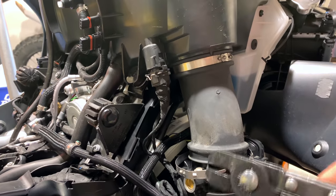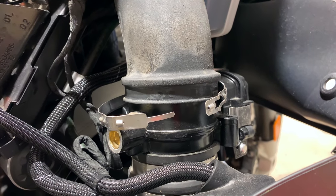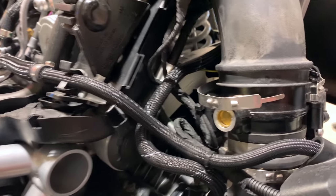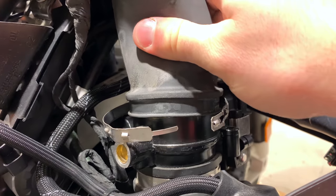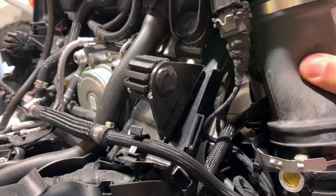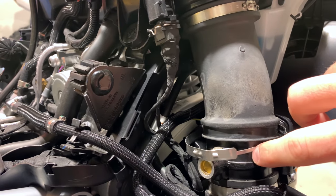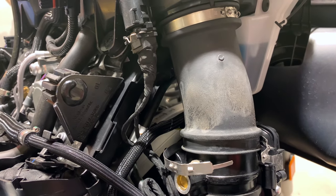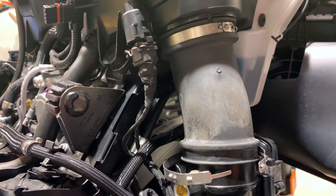You may need to put your finger on this piece to help it around. Once that's done, you can yank the air box right off. Don't use any tools here — you don't want to scratch it, and you want a good seal between the intake and the cylinder head. I'll do the other side and then we'll pull this thing off.